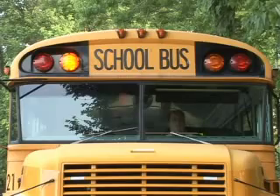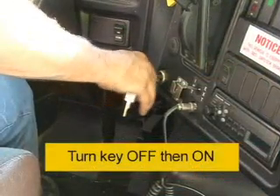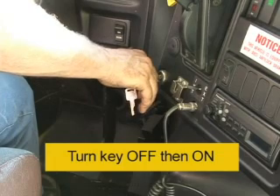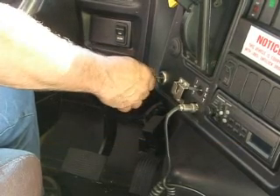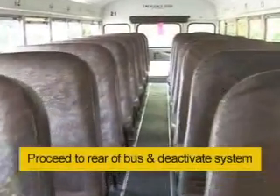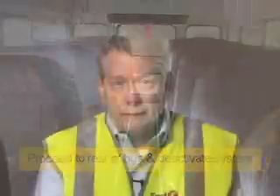If the motion sensor is not working, you will hear: 'Warning — motion sensor is not working.' To complete the diagnostic process, activate the eight-way system — you will hear 'Child Checkmate is now activated.' Turn the key off then back on; the system will instruct you to 'Please conduct your child search now.' Proceed to the rear of the bus and deactivate the system — you will hear 'Child Checkmate is now deactivated.' You've just completed a full check of all the components. If you did not receive a confirmation of one of these components, you've found the problem.